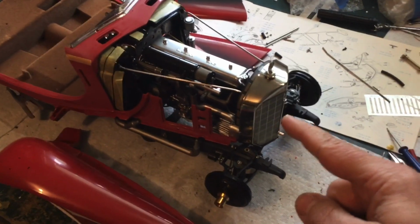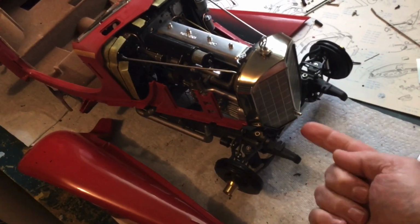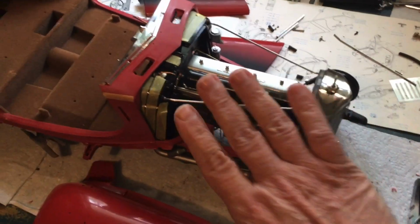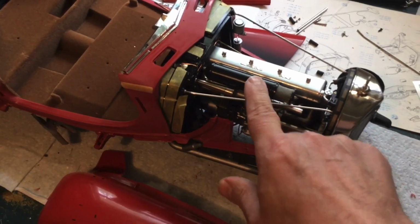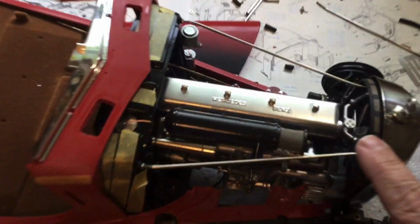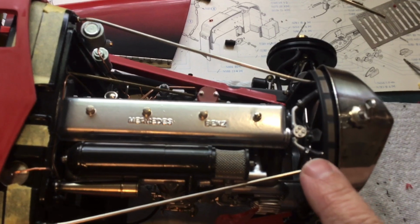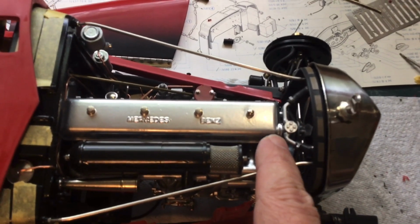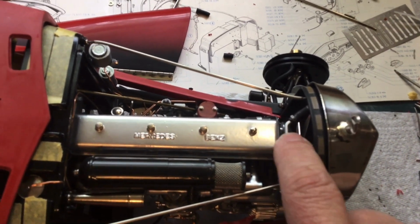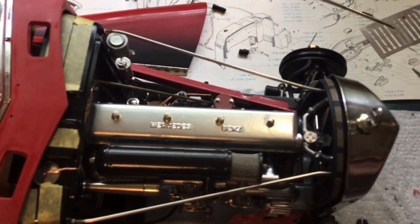Up and down, basically there's like a screw and a bracket down here. If you loosen that screw, this will shift up or down a few millimeters. I have it shoved up far enough to where the hood panel does not contact the air cleaner box here. If I go up any more, it's going to really stress out the hoses, which, man, they really don't fit very well at all. I'm not liking how the hoses are there. What I might do later, if it bugs me enough, is get a heat gun with a tiny tip on it and heat the elbows on here and here just to flex those up a little bit so the hoses line up a little bit better.